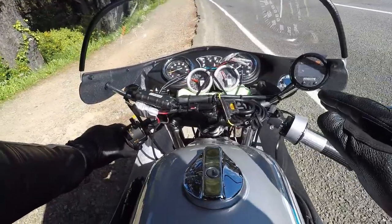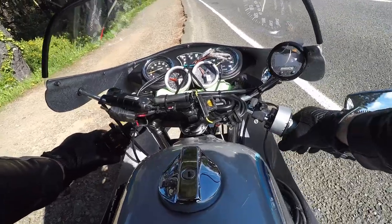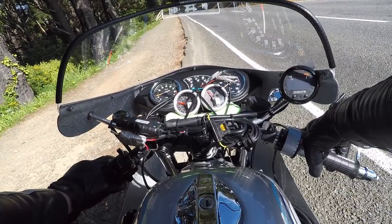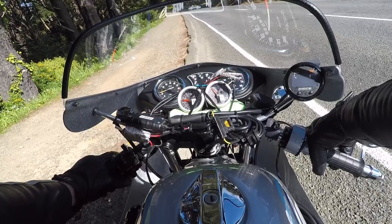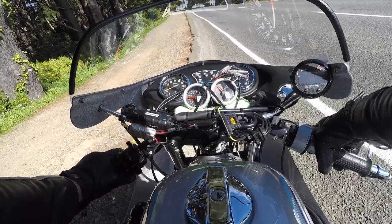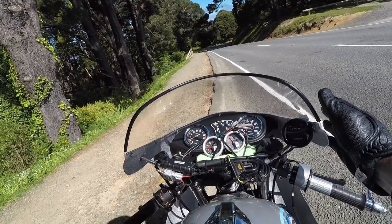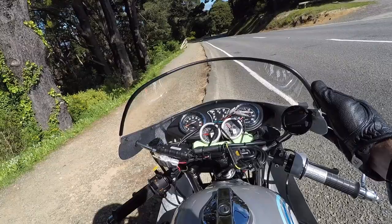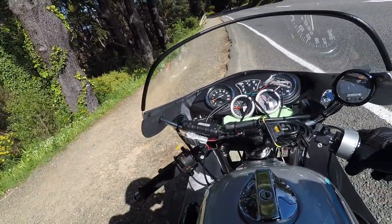At this point, when I've got it idling like this, it'll be the idle mixture screw that's affecting that. However, I'm finding that the A cylinder is a little bit richer all the way through. Now it's almost 12.4, and the bottom's 11.6 or so. So it may be the case that tweaking the bottom one, the back cylinder, I could bring it up to the same, like 11. I might see what that does when I get on the flat.